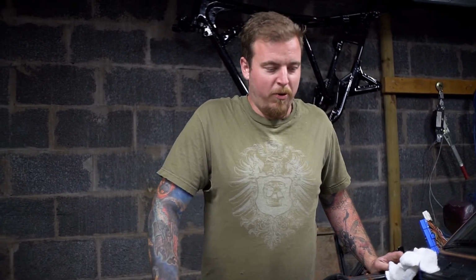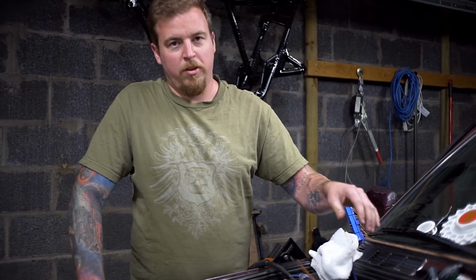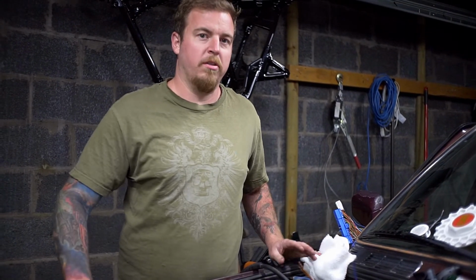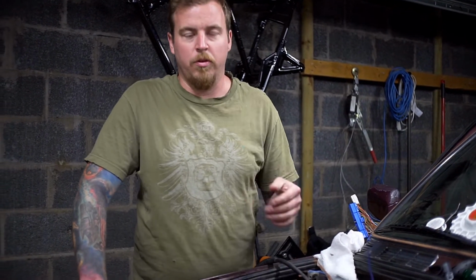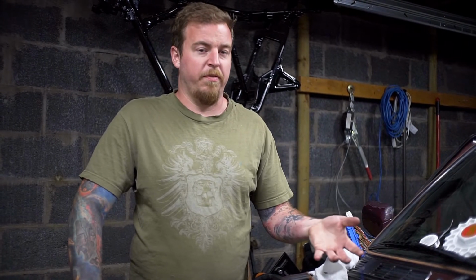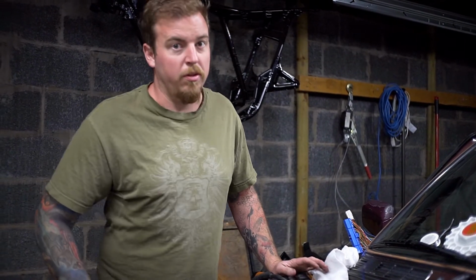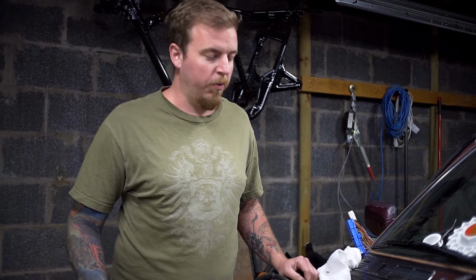Okay, so at this point, we're going to start merging the SR20 harness into the E30 harness. Now, there's two very important things on our build, and this is going to be true for yours as well. This is a pre-facelift car, so our wires are different colors than the facelift models. And this is also a J4 ECU SR20, so the pinouts and some of the wiring colors are going to be different than other SR20s, depending on what you go with. With that being said, this is rather straightforward once you do all the legwork, which we have done.